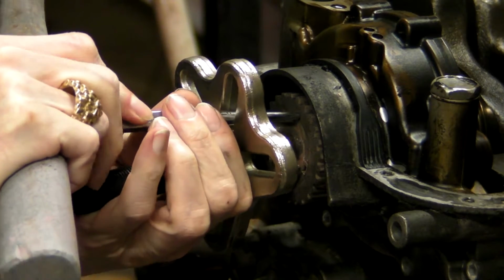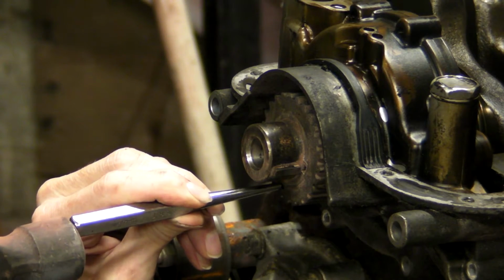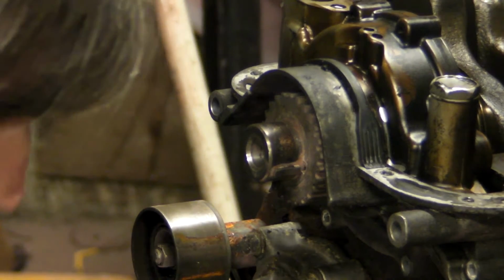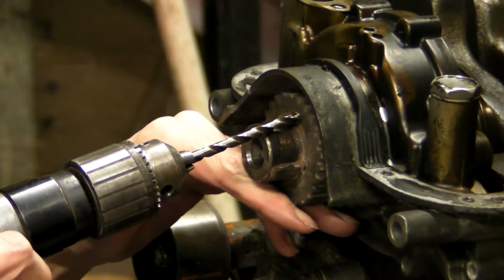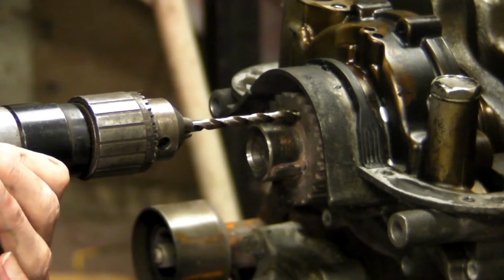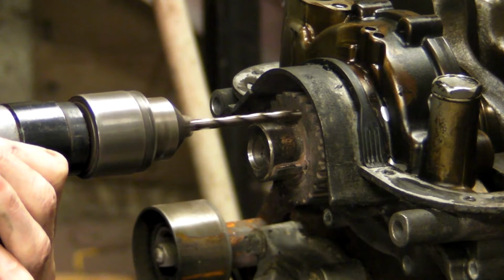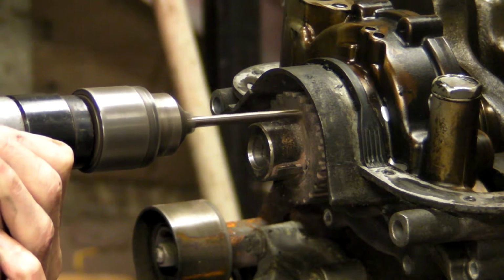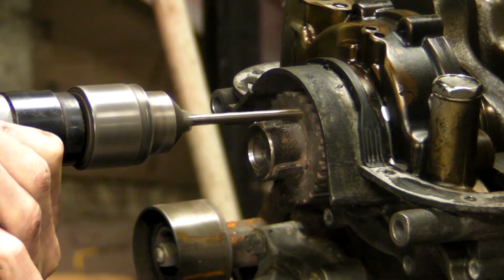First thing we're going to do, or door number 1, is to use a nice sharp punch. Get some divots punched into the gear so that we can locate our drill bits, and they need to be straight across from each other, so you can use a standard style straight puller. Then we're going to drill these out to accept 1/4 by 20 threads. You do need a nice sharp punch to do this. They're cheap and easy to find.